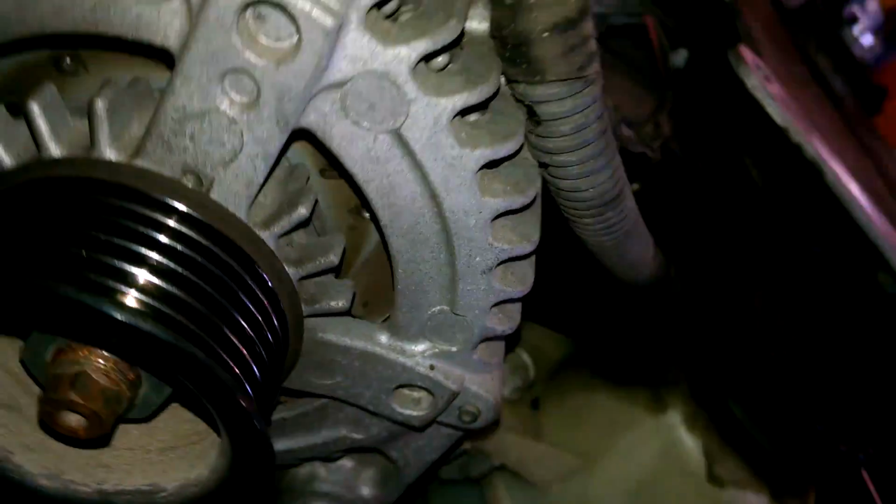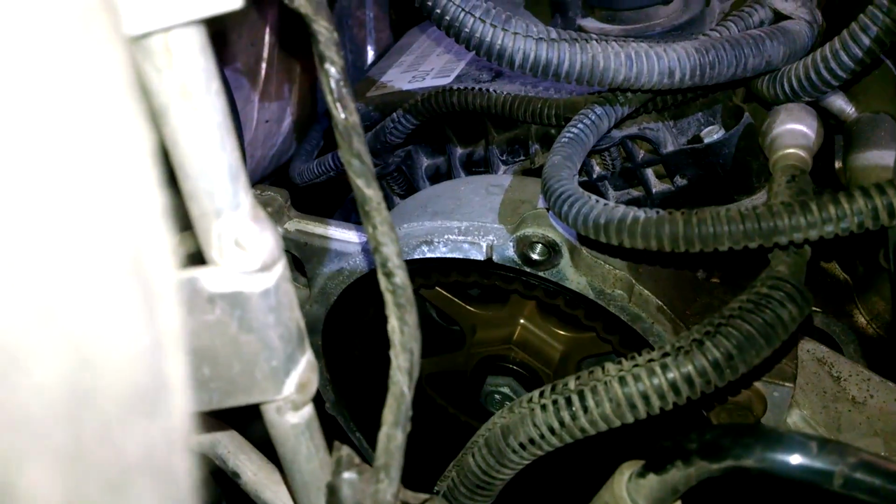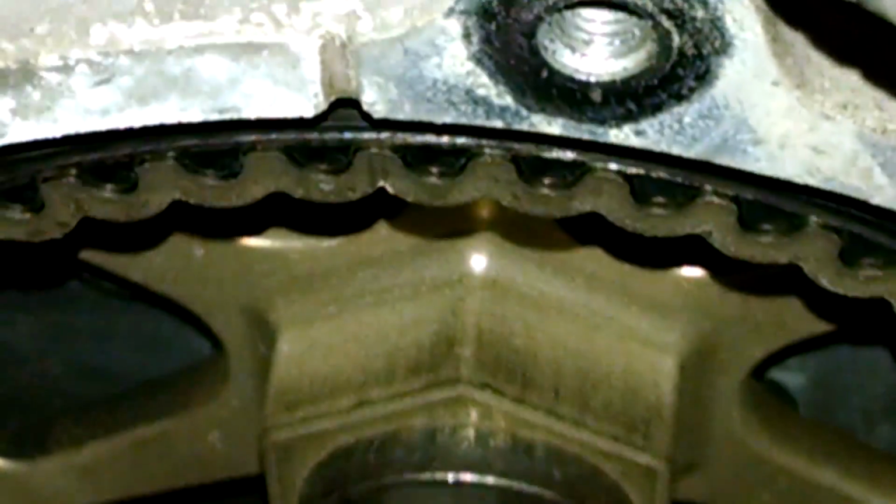And then we'll check our camshaft marks, and they're going to be right on or 180 degrees off, otherwise known as they'll be pointing down. So if they're pointing down, we need to turn the engine over right here another 360 degrees and line up our top dead center again, and then our marks will be correct. But we'll go up and check the marks. So you can see the marks do seem to be lined up. In the front and the back, so that's a good sign.